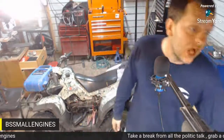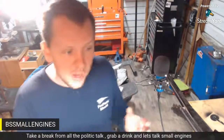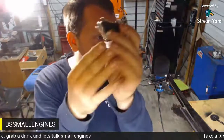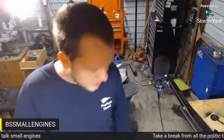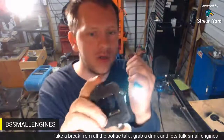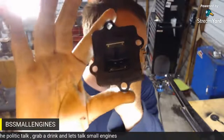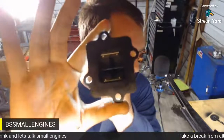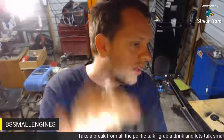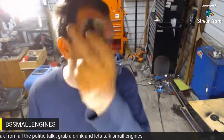I've seen new carburetors come in dirty before. And then the second thing I thought is possibly reed valves. So I went through here. There's a tiny bit of light, but not like major light coming through here. Let me see if y'all can see this when I shine the light through here. That might be a lot of light. I don't know if I should replace if that's too much light, or if I should just go ahead and replace the reed valves. They ain't really that expensive. I think this part's like $17.